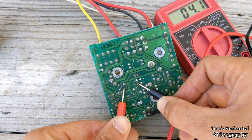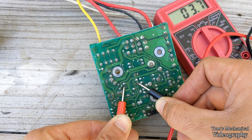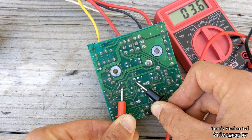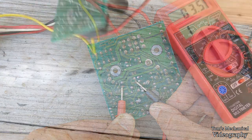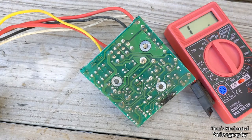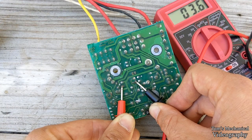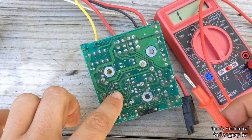And if we check over here on the 3.3 ohm, if you let it go long enough, it'll actually get down into spec. It's allowed 5% tolerance, which is up to 3.45 ohms. Just a minute ago, I got it to read 3.4. These carbon composition resistors apparently better handle amp surges. They don't fry as easily, and that appears to be correct, but it makes them harder to get, a little more expensive. So this one may still be good, but we're going to replace it anyway because we're already going to have to pull stuff off the board and re-solder. But that one may not be totally gone.